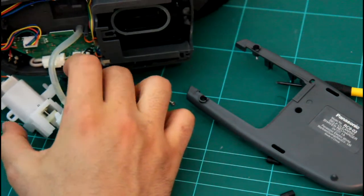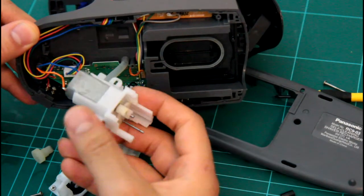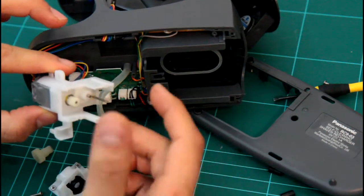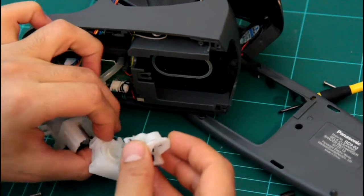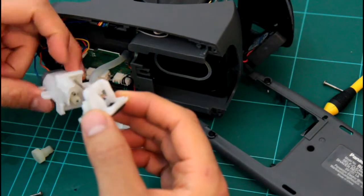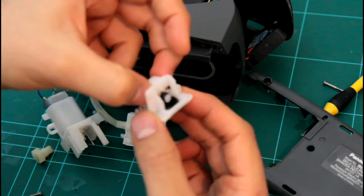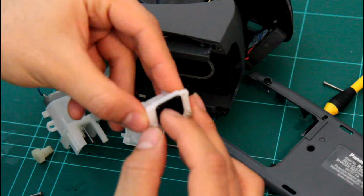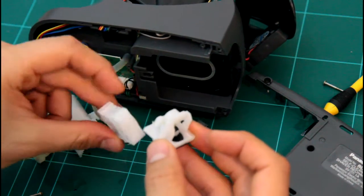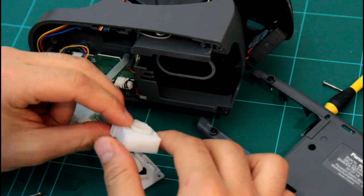And I thought it's got a proper pump, but to take the cost down, what they basically did, they're using a very cheap DC motor, and then with a bit of gears, increase the torque, and very simple smart idea for the pump. So basically as the motor turns on, this thing will go up and down, and this plastic or gasket type thing will go up and down very quickly and act like a pump, because in here there's like a sealed chamber on this plastic casing.